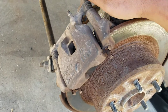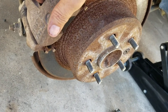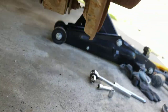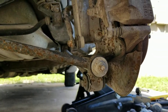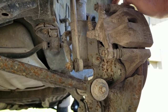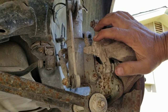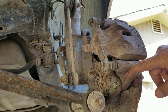You're gonna make it harder on yourself if you don't take this off first, because if you're gonna replace a rotor you're more or less gonna have to push that piston back in the caliper. Otherwise you won't get that back on there. So I'm gonna remove these two bolts and loosen those - I'm gonna pull this off and push the caliper back before I pull this off, that way we get the hard part over with.